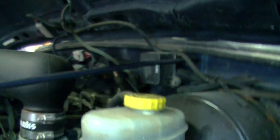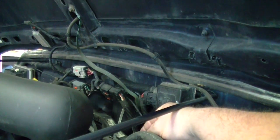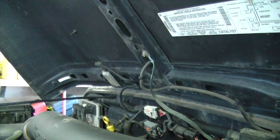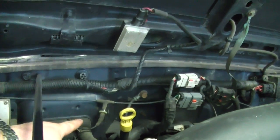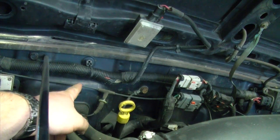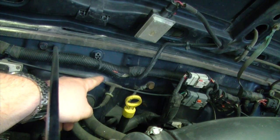When you shake the vacuum line, you can see up on my firewall — the vacuum line comes up from behind the brake master cylinder and here's the vacuum line right here. It is possible that this vacuum line could be torn in any place and you could see it right along the line here, all the way along. On the Jeep, we've got a vacuum line going in where the heater hose is. There's another check valve there. You can remove the line to any one of these spots, start your vehicle up, and check for vacuum. With the vacuum gauge at either port, check both ends.